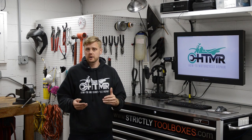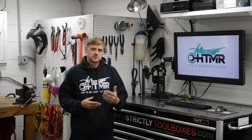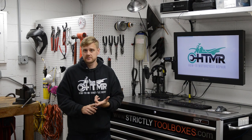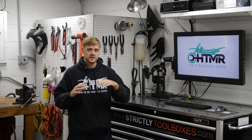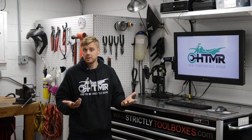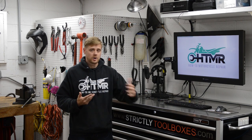All right, guys, in this video, we are going to be prepping the block for assembly. So we're going to chase all the threaded holes to clean out all the dirt and debris. We're going to tune up the gasket surfaces by scraping them. And then on the decks, we will be sanding them to check for flatness, to just see how they turn out, and just to tune them up a little bit. And then we'll just wheel it outside and give it a good bath and then make sure all the oil passages are clean.